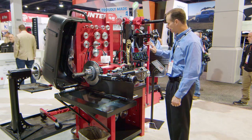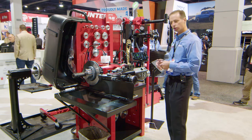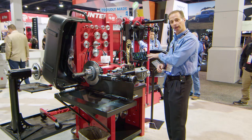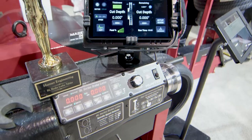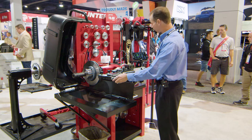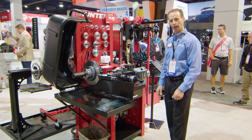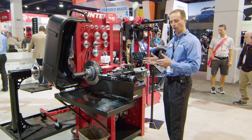The other thing that's really nice about this is the display. We can display much richer information. We can give animations showing the technician what to do, and there are training videos present in here. But probably the other key feature is this thickness display right here. In this case, I'm in the green — I'm good. But let's say I'm working on this, cutting away rust and grooves in the rotor, and all of a sudden that turns red. Now I know that this is below specification and it needs to be thrown away. That's very important.